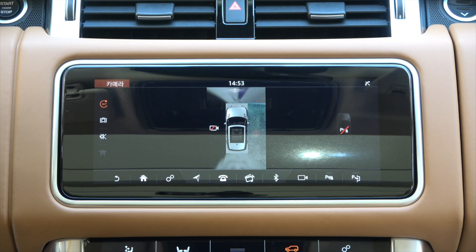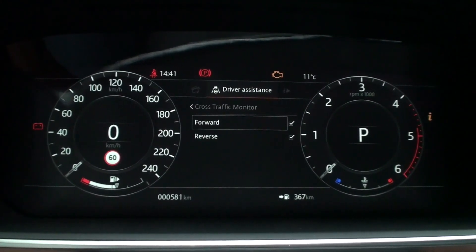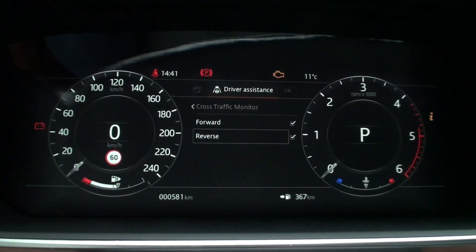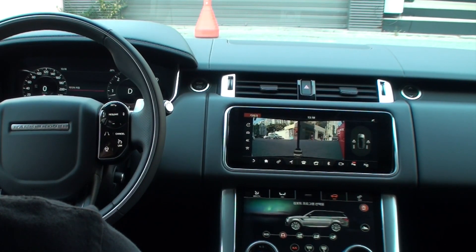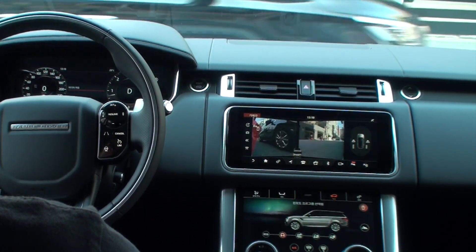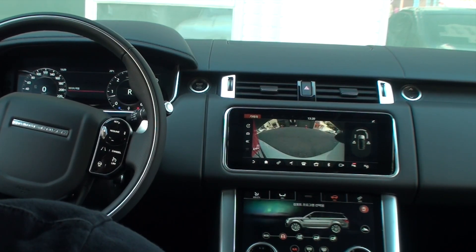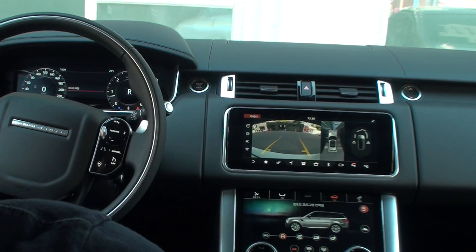Please remember which part of each of the four cameras on the 360-degree surround camera screen you are currently viewing. Closing the passenger and driver's doors will reactivate the camera. The driver assistance menu in the instrument panel provides an optional cross-traffic monitor. If the vehicle has a surround camera system, it is divided into forward and reverse. When the gear is in D mode at low speed, a warning light and sound alert you when an object approaches from the left or right of the front of the vehicle. Without a surround camera system, the warning activates in R mode when objects approach from the rear.